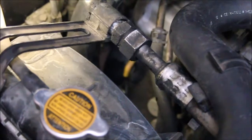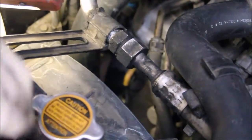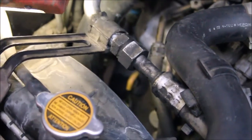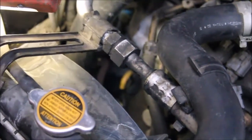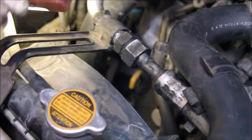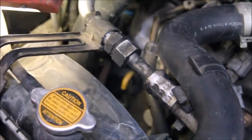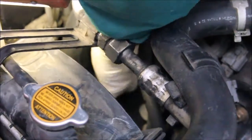With the car in place, I turned the engine on and just shifted the gears all the way from low to reverse, neutral, and all the different positions with the car in place. Let it run just a moment or two, put it back in park and turn it off. So let's check the fluid level one last time.